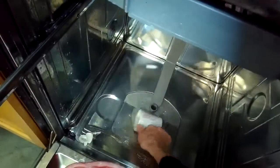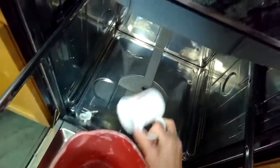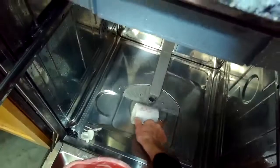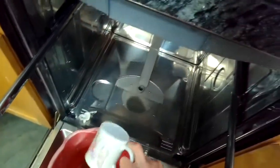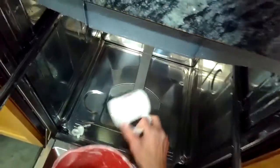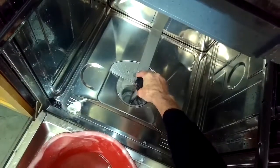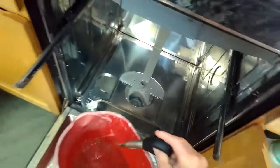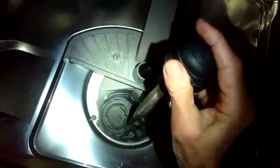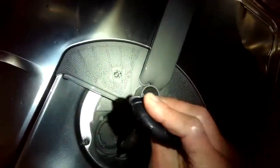So I'm going to unplug it and do a little more investigation. I'll pull off the upper rack and use a cup to get the water out of there, so I can see what's going on better. I usually use a cup and a bucket, but a shop vac is a really fast way to do this. When I get lower down I use a turkey baster to get the remaining water out, because a cup won't fit in there — the turkey baster works pretty well.